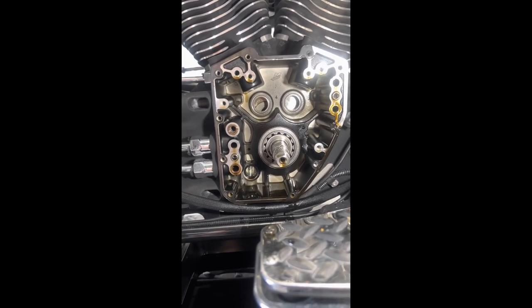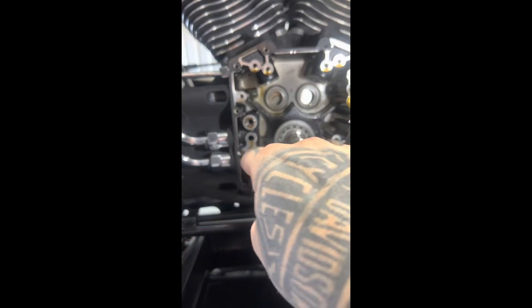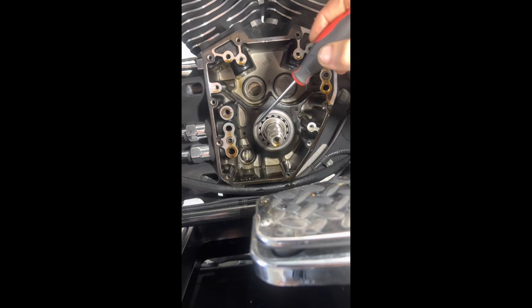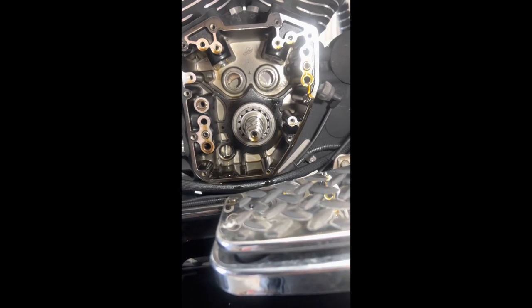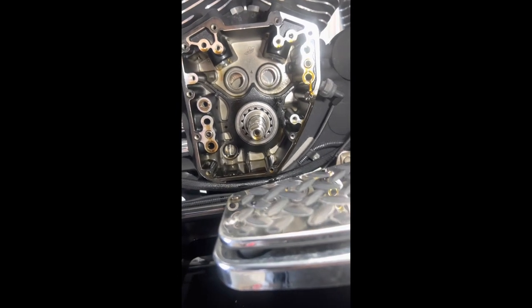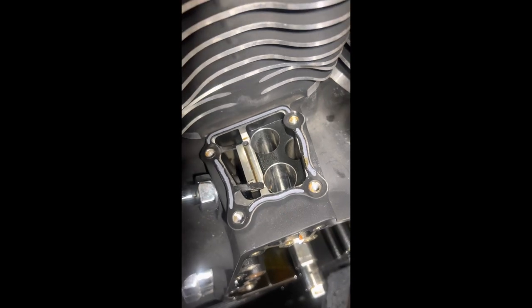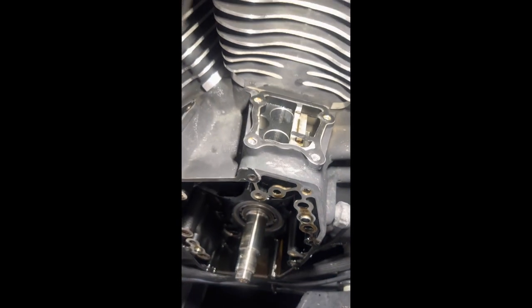We'll go through some of that on the next part. If you do it at home and that's not in there, we're going to see oil pressure come down in the motor, which is no good. So if you're seeing a seat come out and it's not sealing going into the motor, we're losing pressure and you're going to see damage on the way. Same with these guys where they intertwine and face off from here to the cam plate itself. Another rule of thumb — I do take lifters out to look at lifter bores. This thing is running really, really good. The abrasion on the lifter body itself is awesome, so this thing's had good oil changes and hasn't been flogged.